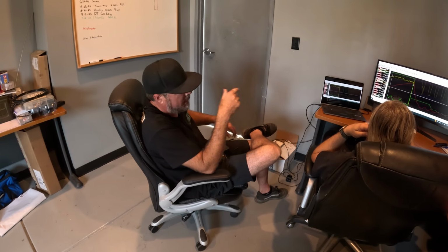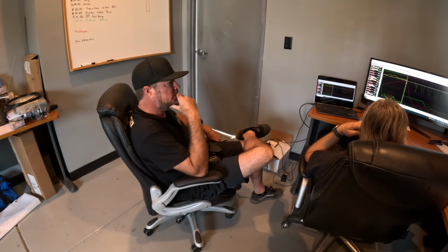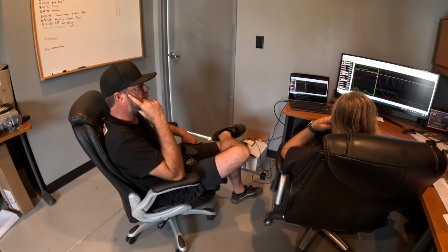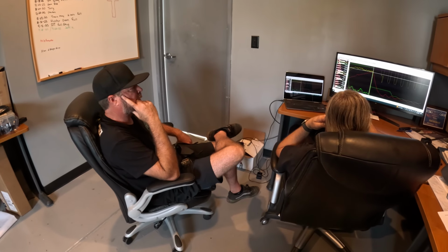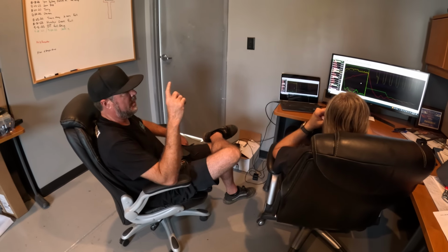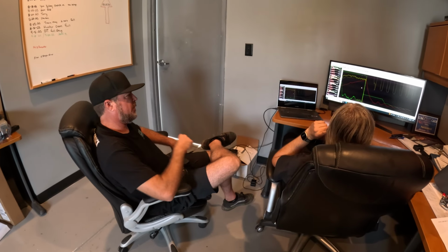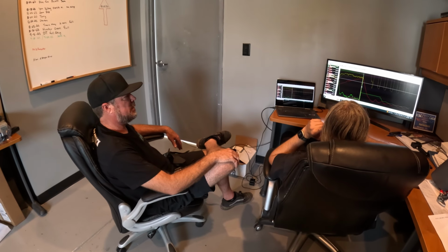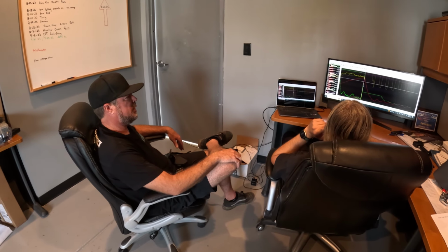The thing I'm curious about is we made 3 or 4 more pounds of boost. Did the air go really hot now with this new injector throttle body? Because we could overlay this run with the old throttle body and the smaller pulley, and we could see, did it make more boost? Did it still make hot air?